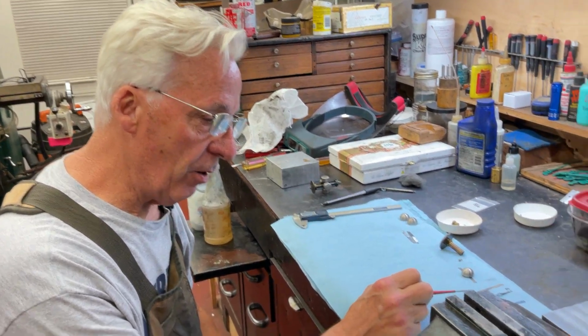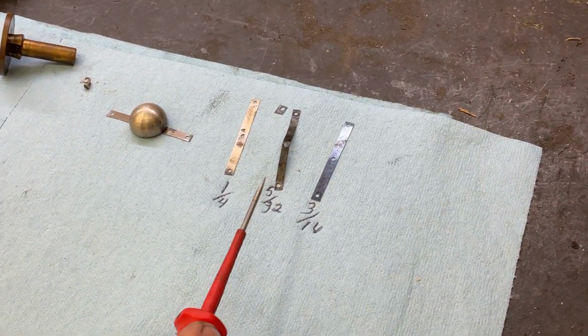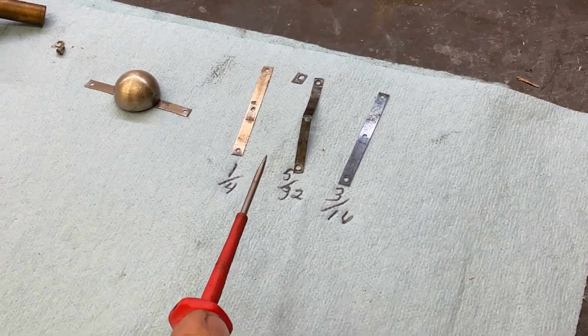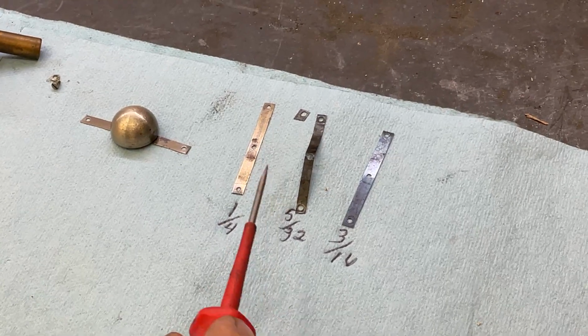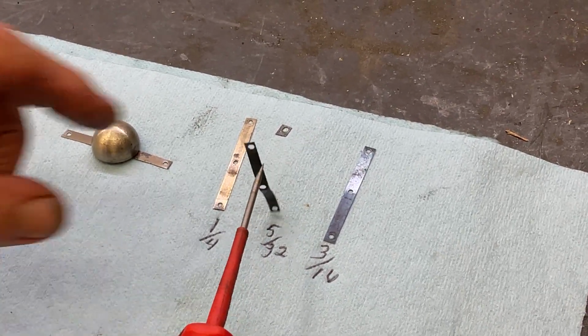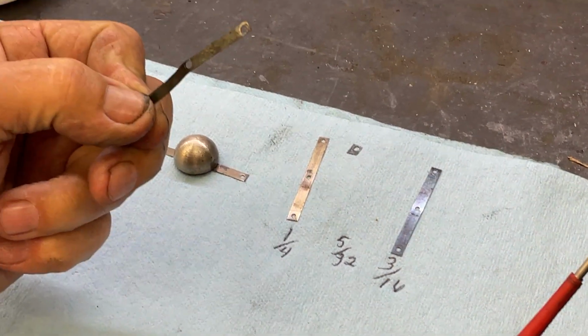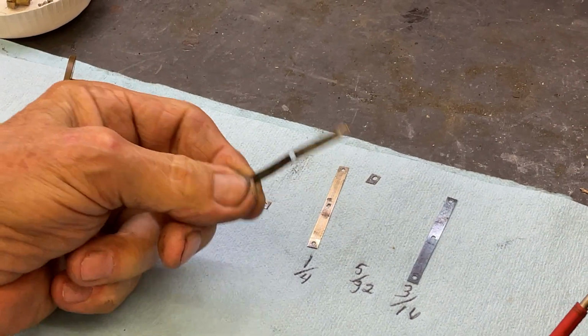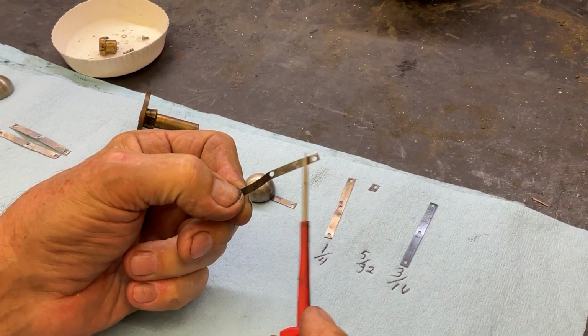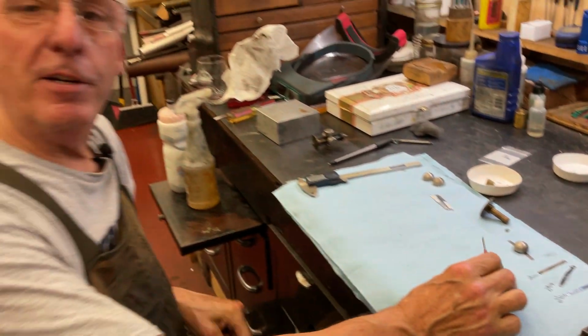You take something apart, you go, I don't think that looks right. And I looked at the governor before I took it apart, and I told my angel, hey, we have to put 3 governor springs in. And she said, why? And I go, well, let me take this apart. I'll show you. And that's the culprit right here. This thing right here, that's probably a Columbia spring. And sometimes they'll shorten them down too, and then try to drill another hole. But that's another day and another story. I hope you enjoyed that, and that's my tip for the day.